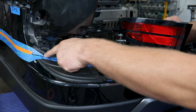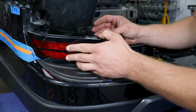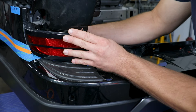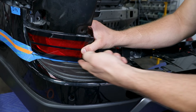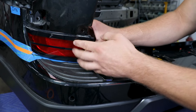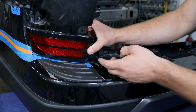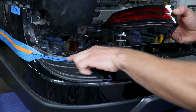Moving in a little further, you need to draw a straight line essentially parallel to this edge and kind of in line with the edge of these raised cutouts, basically lining that up with the inside edge of this rectangular cutout that was originally for a clip. You can use any straight edge to lay that out and mark it — it's not a super critical spot. Continue that along the side moving in toward the center. What we're aiming to do with this cutout is essentially hide the cut edge underneath this reflector once everything is complete and reinstalled.